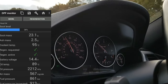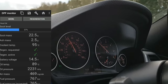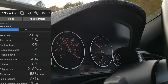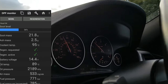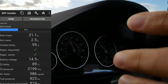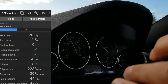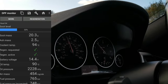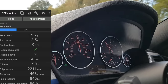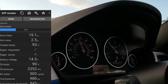This approach by BMW tells me they don't really encourage you to look after your car. They just expect that your DPF is going to get blocked, and then once you come to the dealership or garage, they're going to ask for a replacement. Especially when the DPF soot level is over 90%, there is no way any cleaning can be carried out — it has to be replaced. BMW's approach to DPF regeneration doesn't really make sense because they're not telling you the exact numbers. All you're going to get in the end is a completely blocked DPF, and replacement in the UK costs at least around two thousand pounds, which is an eye-watering price.